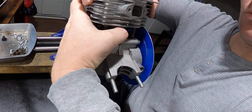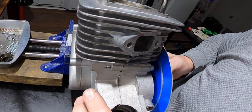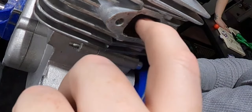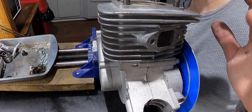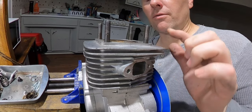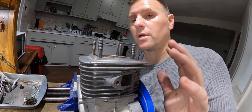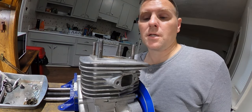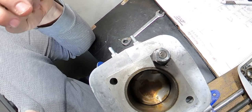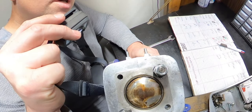Okay, guys, so I put you here on a weird angle just so you can see it. I don't think you're going to be able to see it anyway, but in here at top dead center. Now, I don't have it clamped down, but there is a tiny bit. So there is a little bit of free port going on in the exhaust, which is a super common problem with these motors. Literally every motor that I have done, every one of these CDH 110s has had a free port slash crosstalk issue. It's very frustrating because the only way to fix it is raising the cylinder and then cutting the top of the cylinder off. I added two extra base gaskets to make sure we don't have any of the crosstalk issue, which we do not at all. So that seals up the crankcase.